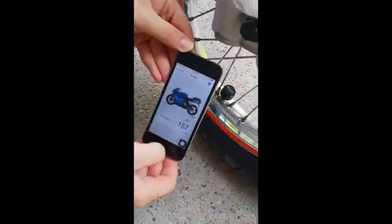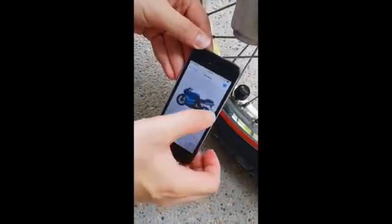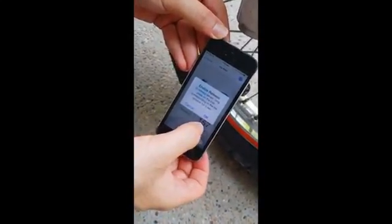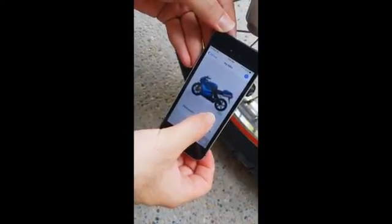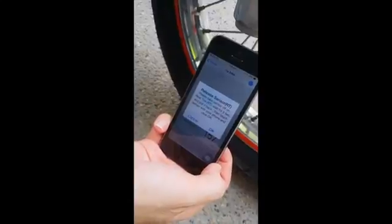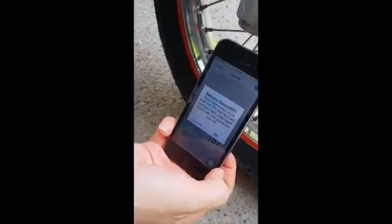As you can see in the app, it says 'release' on the front tire. Now I want to proceed to remove the rear sensor. Same procedure: tap on the settings screen, tap 'release bike sensor.' It will tell you to hold down on the sensor box for five seconds. The message will prompt — do not click OK yet. Follow the instruction: remove the sensor from the tire valve, wait eight seconds, reinstall it, screw it back onto the tire valve, and then click OK.